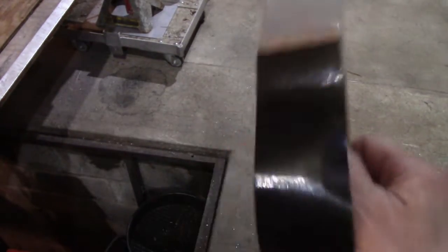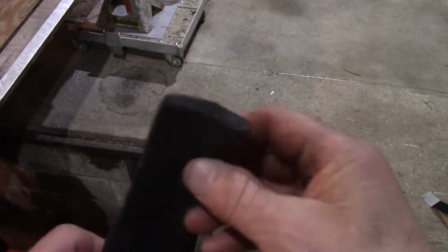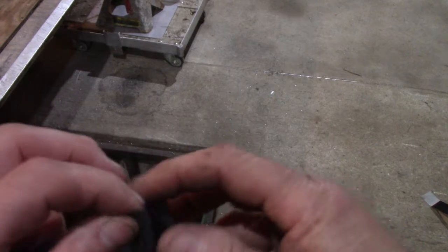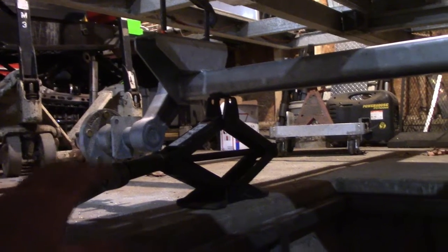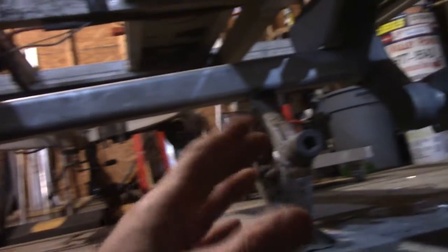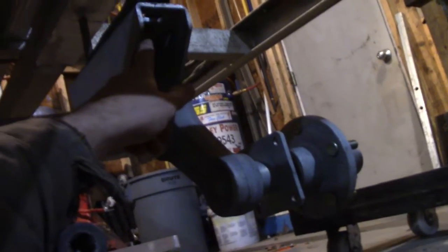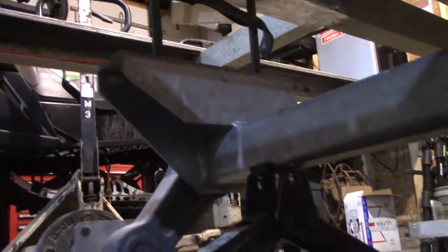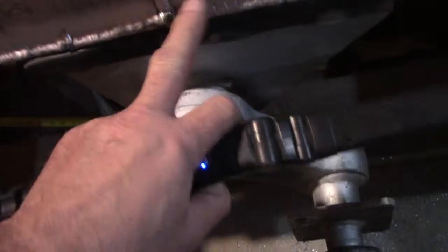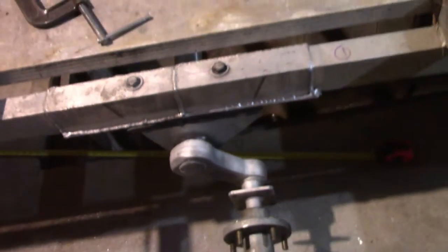What I ended up doing is leaving that side down off the jack on the floor and got one of these scissor jacks under here, just getting one side up. I'm working alone here — if you can have somebody to help you out, do it. This axle is too heavy for me to lift and try to thread a bolt and keep it in place. So I put my rubber on first and then got the two nuts started on there, and now I can take that out of there. I've got another scissor jack and we'll just go ahead and jack her up.